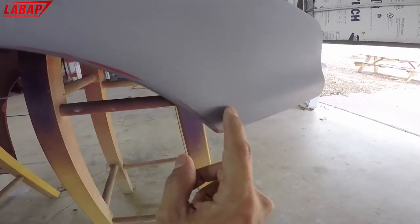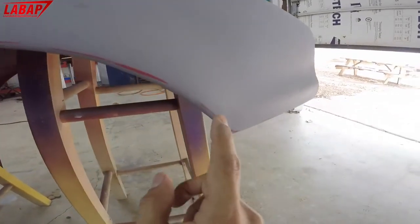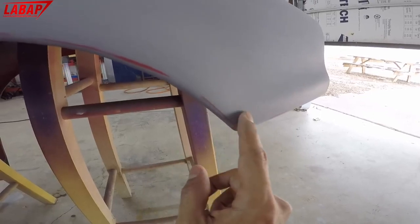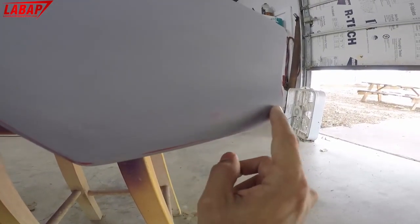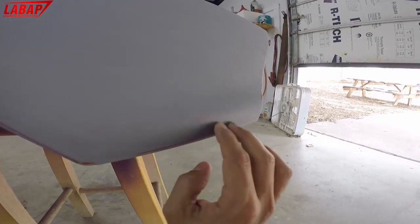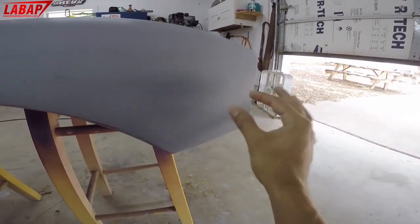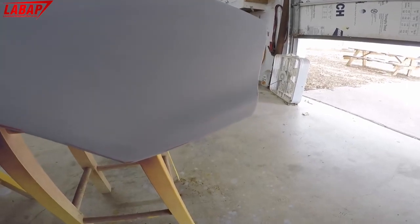If this is a customer job or a job that's supposed to be a pro job, we wouldn't let this slide here. You can see that there's some primer that wasn't really blocked out in here. You could see, not the overspray, but when you were spraying with the primer, little drips and nabs of primer. Because when you spray with these aerosol can nozzles, they're not the best nozzle, and you'll get specks of drops in it as you prime. It is what it is. That's what happens.